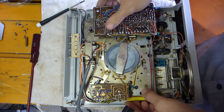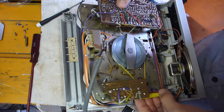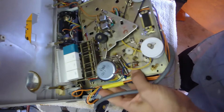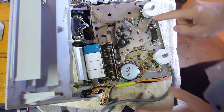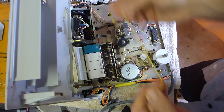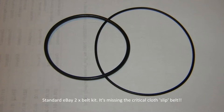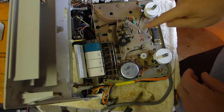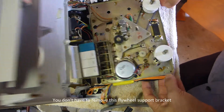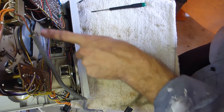So I've taken off my leads and then the whole thing just comes out. We can see that we've got a belt there and a belt here — so this one's obviously had it and I've got to replace it. To get access to these belts you need to remove the pinch capstan wheel, which is connected to the flywheel on the back. To do that I'm going to take off these two screws there and there.